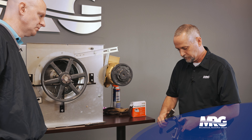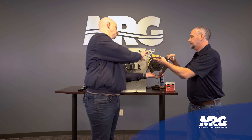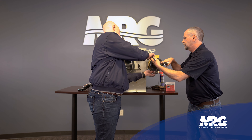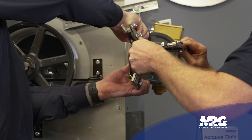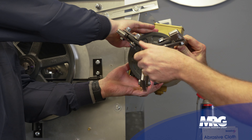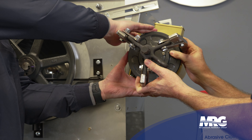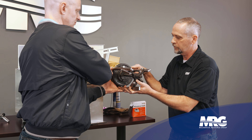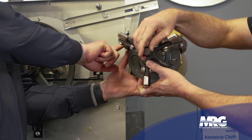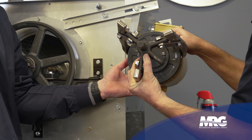This puller in particular can be configured as a two-jaw — you can remove jaws and put them anywhere. If we just had one on each side, we'd have a two-jaw puller. But any chance you can use the three-jaw, you're getting another point of contact and it's going to pull it off better. We'll do a quick demonstration of how this will go. These things are a little tricky, so it doesn't hurt if you've got an extra hand. You would normally have a socket or a wrench on that center bolt turning it — it's really important to keep that contact there as you're turning it. If one jaw were to drop off, you could bend or warp this.